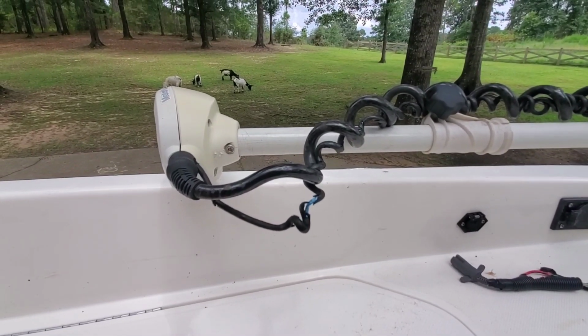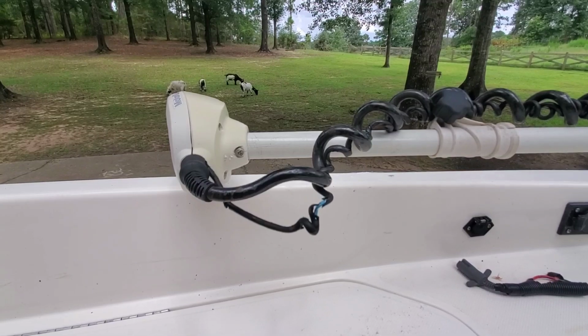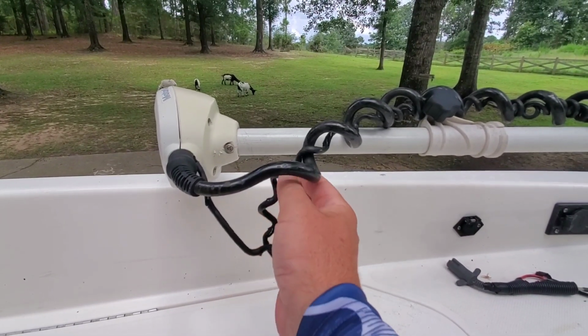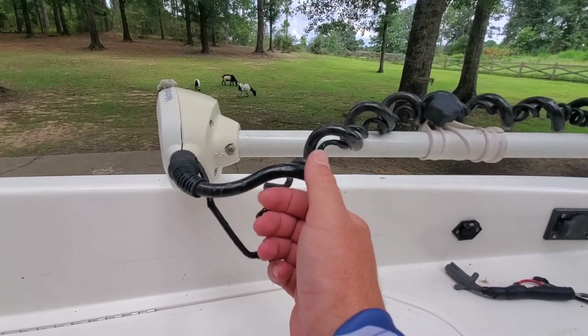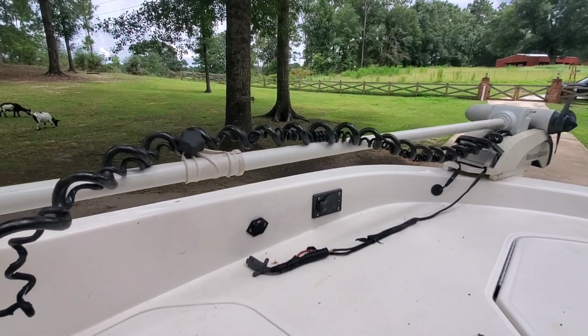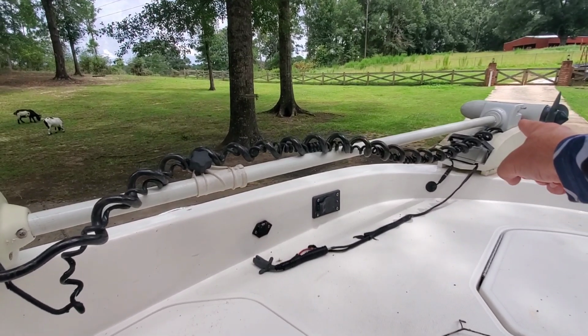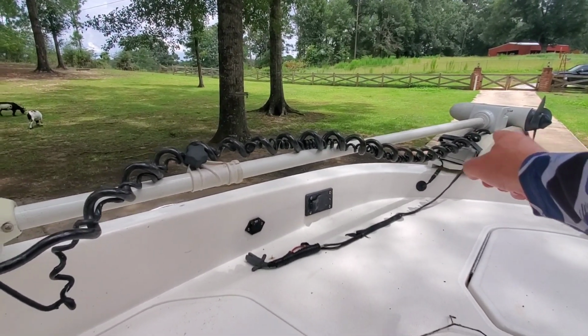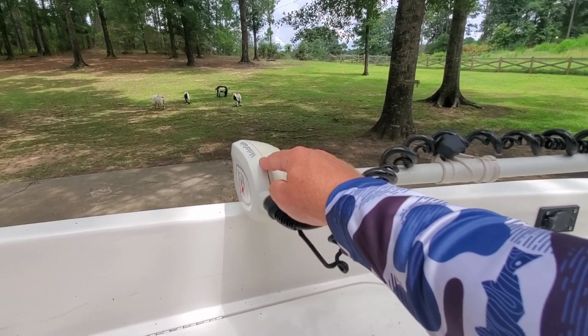We're going to take this thing apart. We're going to swap out the GPS modules and rewrap this GPS cord around the inside of the power cord here. And to do that, we're going to have to take some stuff off the front of the platform here, and we're going to have to take the head apart.